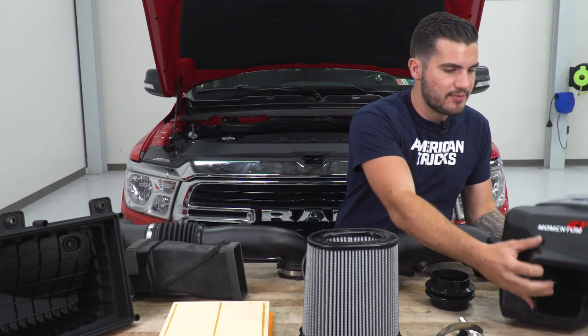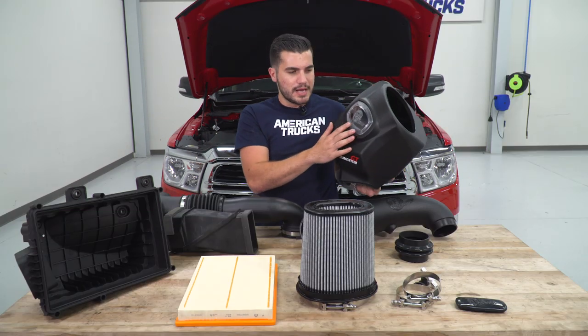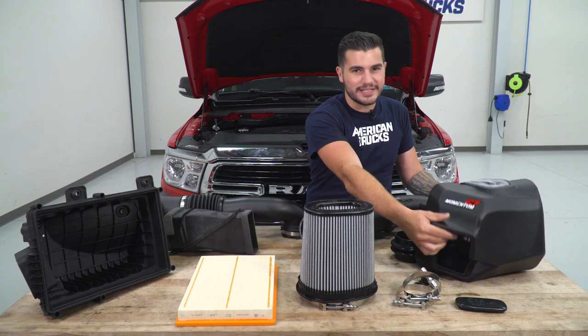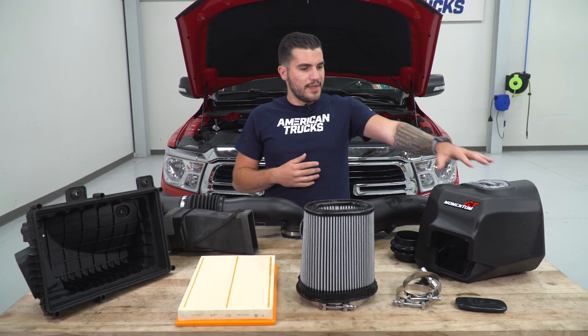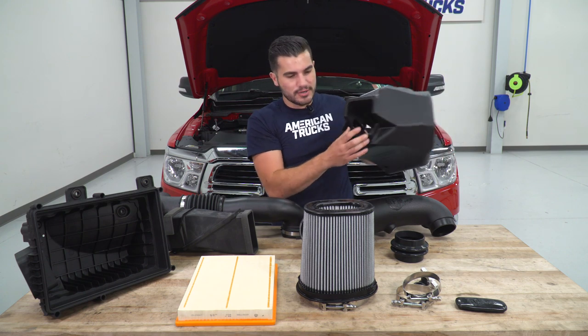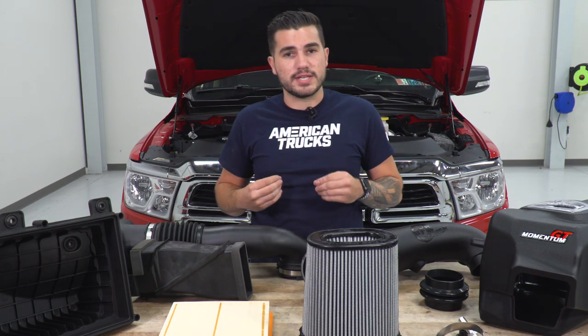Finally, the big key player in the kit aside from the filter is your airbox. This is a completely enclosed one-piece design in that same XLPE material to dissipate heat. It's got a plastic window on top with the AFE logo, which looks pretty good but also gives you a view of your filter condition to let you know when it's time to clean it. Cleaning is pretty simple: pop the filter out, use pressurized air to clean it off, and throw it right back in. A benefit of a dry filter is that it doesn't require as much maintenance as an oiled filter. It also uses this inlet here to connect to your factory air duct, which pulls in air from the front grille — and you're gonna be retaining that in this kit, which not many kits on the market will do.